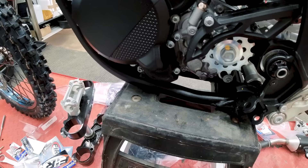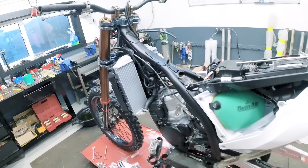One thing I found on the bike in America — it's got a 14 on. It had a 13 front sprocket on and I went back to a 14, which for me was way better. I actually run a 12 on my TPI, which a lot of people are shocked by — not obviously for extreme, everyone uses a 12 — but for normal racing, enduro and that. So this bike felt quite aggressive, or the one in America did. So it'll be interesting to get it on my track.